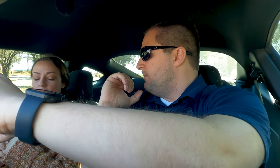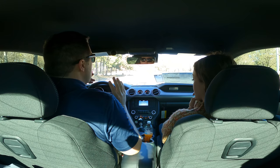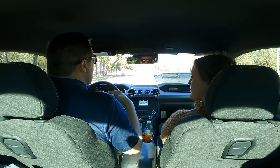They're separated. Okay. So if I sit here with my foot on the brake, and I slowly let the clutch out, you're going to feel the car starting to vibrate because my foot's on the brake. It's not letting us roll. The engine is still spinning, and the clutch is trying to engage everything, but it's not going to let me. So watch what happens when I start to let that clutch out. You're going to feel it vibrate, and then it'll die. Feel that?